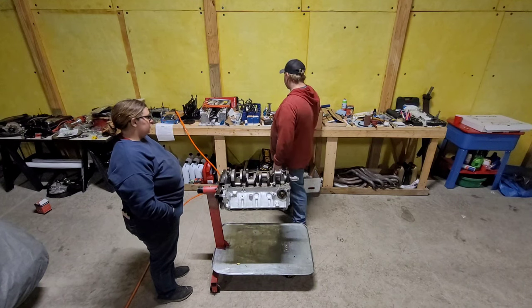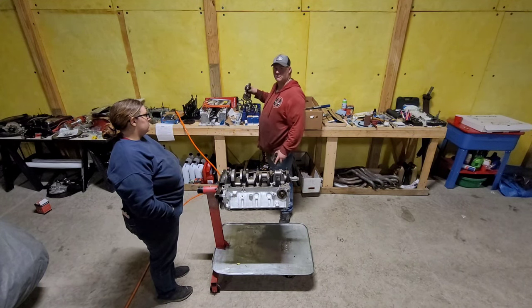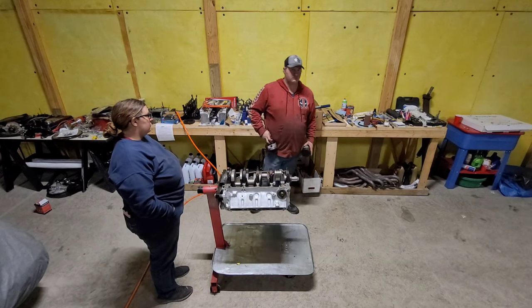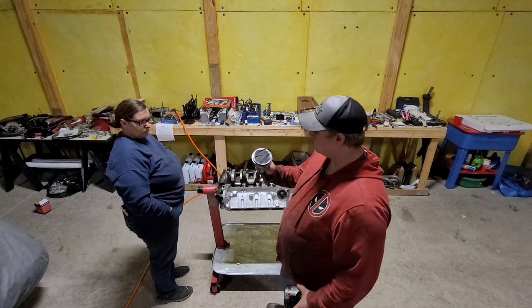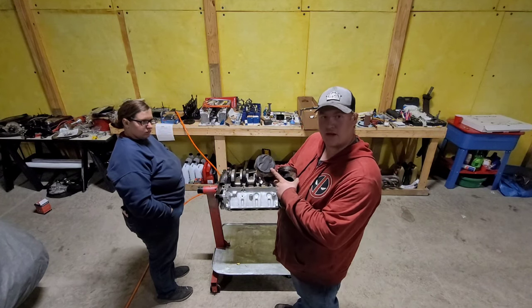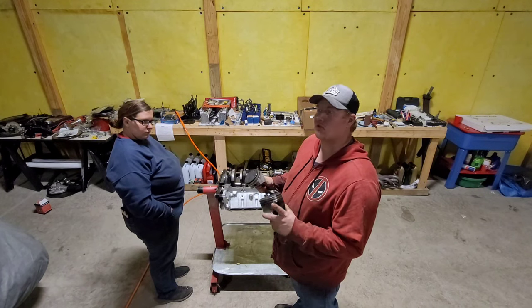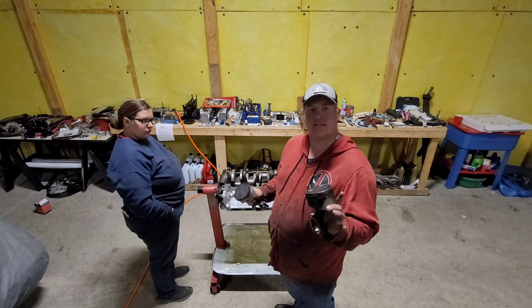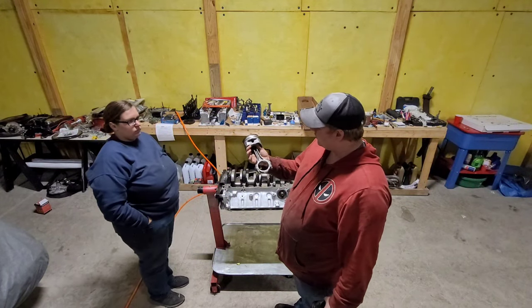Now, we covered this in the other video. I'm not going to point to a side, I don't know where it's at, but there's another video before this one, last week. So these pistons we're using are forged Fox body pistons out of an 86 to 89. And we put them on 351 Windsor rods.